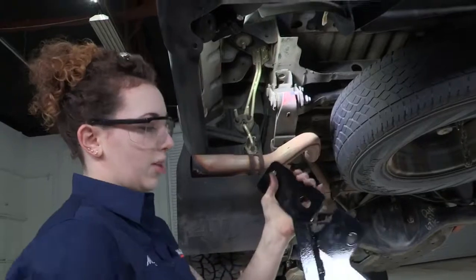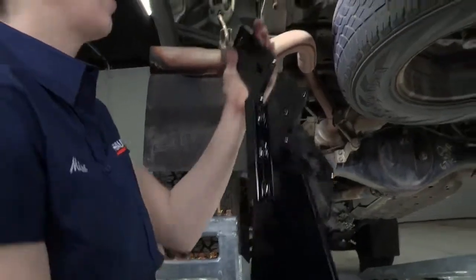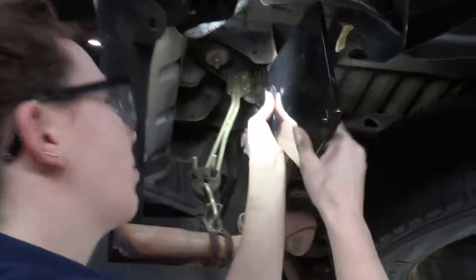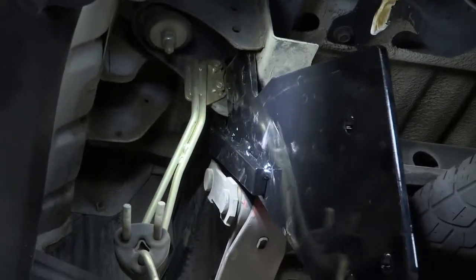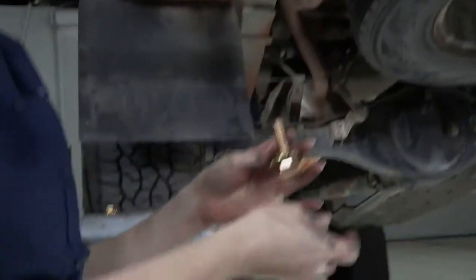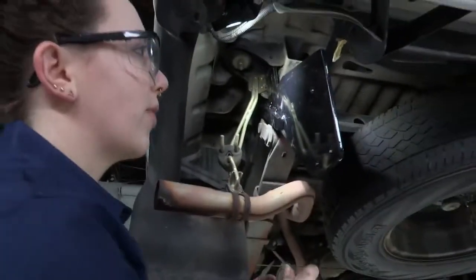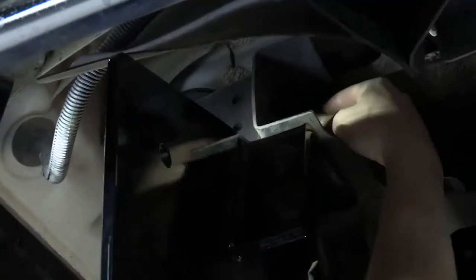So we have our hitch bracket. Just make sure that this piece here is facing outwards away from the vehicle, as the pieces can't go on the opposite side — you don't want to put it on backwards. We're just going to slide it up over the leaf spring bracket and make sure that this notch is fitting into our exhaust hanger bracket there. You can see how those holes line up. You can rest it there for just a second while you get your hardware together. We're going to start with the rearmost piece of hardware, which is just a bolt with a washer. I have my nut in hand so I can secure it and it'll hold the bracket in place while I get the rest of my hardware together. I'm just going to lean it up, insert my bolt, and get the nut on there just enough to keep this bracket in place so it's not going to fall down.